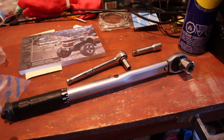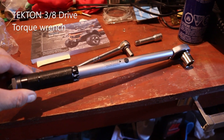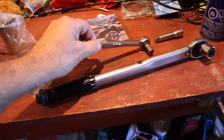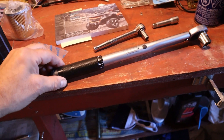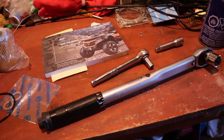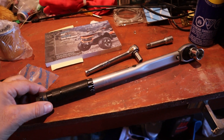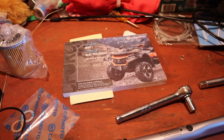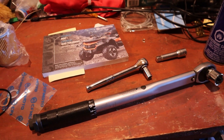For today's oil change you need a 17-millimeter socket for the oil drain bolt, and I'm using this torque wrench. I got it a while back for jobs like oil changes on my cars. The longer bar gives you extra leverage, and it's also a torque wrench. The manual says to torque the drain bolt to 18.4 foot-pounds. I've seen other videos where guys say 25 or 22 — you hear different numbers — so I recommend going by your manual, because maybe you have a different machine.